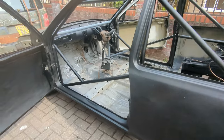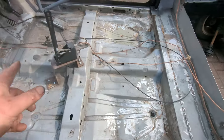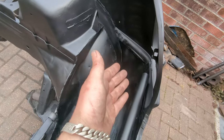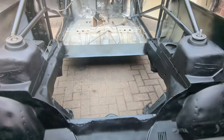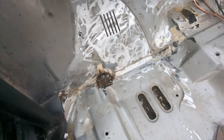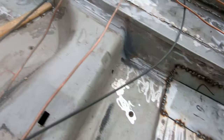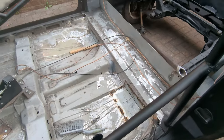After the primer I might have got a bit carried away with the paint. It's not all ready to paint yet - on some bits I'll have to sand off to put more bars in - but might as well give you an idea what it looks like. This looks cleaner - if you pay attention you can see all the cuts and stuff but already a lot more discreet. On the new little holes I'm going to patch - ironically all the sealants they make to stop the water, when I remove them nowhere is rusted apart from under the sealant, so yeah, good call removing them.